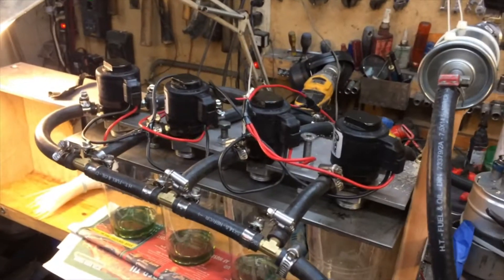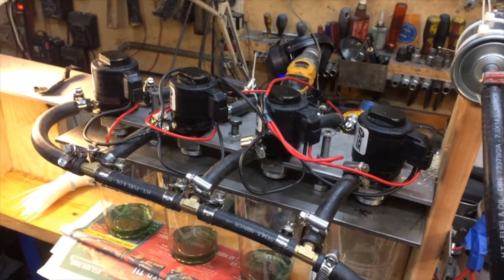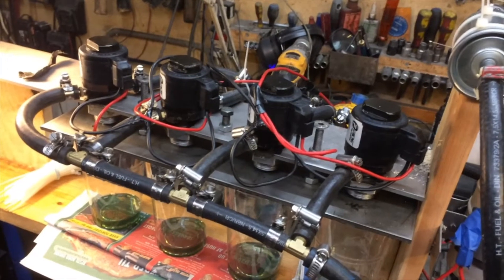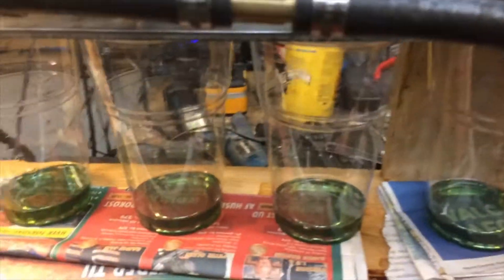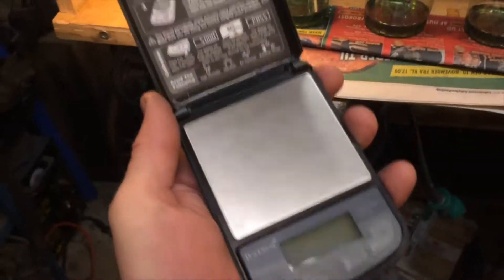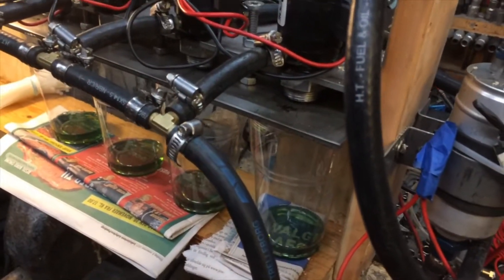These injectors were just taken off a month ago and I haven't done anything to them. I expect to take them apart, look them through, clean them, and then put them back together again, just to make sure they are properly working. They look quite well actually. I'm choosing to run a little more fuel through, and I'm using my coffee scale here to weigh the amount of fuel going through each one, so I can calculate if one is way off.